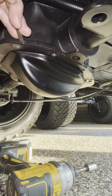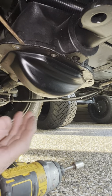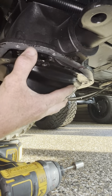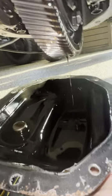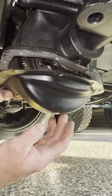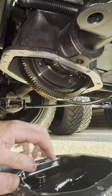Take a screwdriver and put it between the lip here. You want to take it and kind of twist it off. You can see the oil sits in the channel there. Sometimes the rear end pan is kind of dented in from hitting bumps. What you can do is take your hammer, lay the pan on the ground on something solid, and hit it so it straightens out.